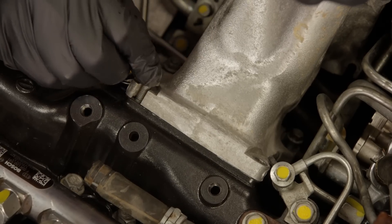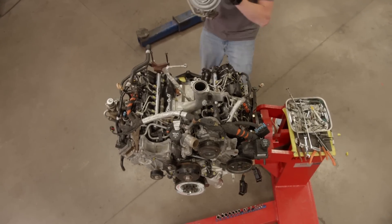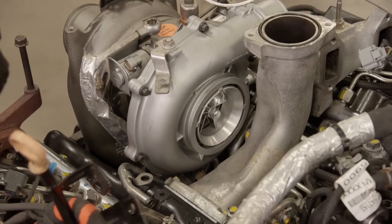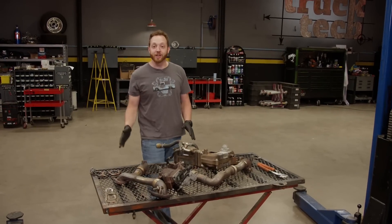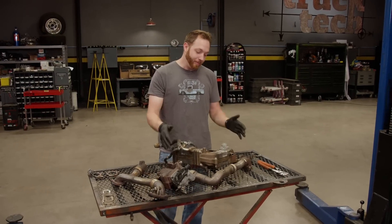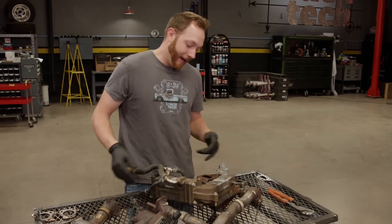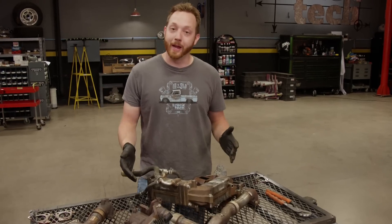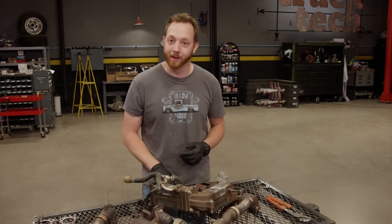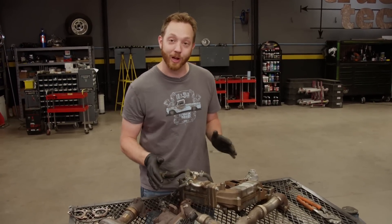On a Duramax, the turbocharger sits in the rear of the valley. And while this type of turbo can be dropped in with the engine still in the truck, it's so much easier to access everything with our engine on the stand. Just about every single diesel engine produced in the United States for on-road use over the last 15 or so years has come fitted with one of these — an EGR or Exhaust Gas Recirculation System. It's quite heavy, it looks complicated, and it takes up so much space it makes it almost impossible to get to anything on the top of our LML. But it does reduce the pollution that comes out of the tailpipe, so we're happy to reinstall it.